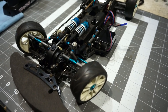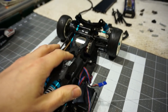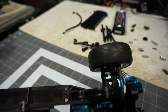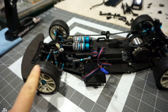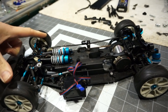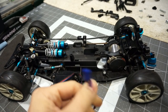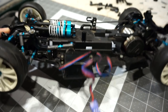There are a couple of things that jumped out at me as incorrect right off the bat. Overall it's got the good TRF 419 suspension, but here we have a directional tire going in the proper way, and here one going the wrong way. Whoever built and glued these on forgot that when you have directional tread, you have to put the other side on in the opposite direction. They glued all the tires on the same way, so some of the tires are reverse rotation. The servo is an Airtronics budget basic analog servo.